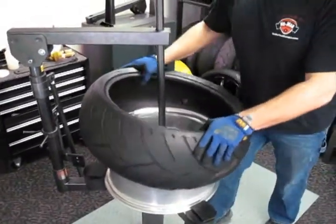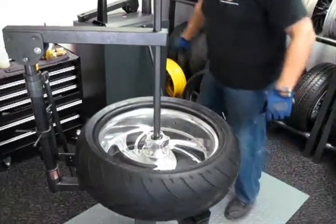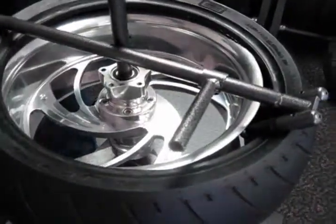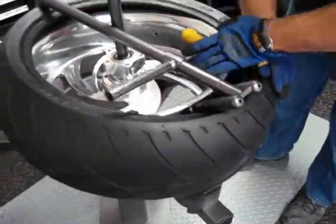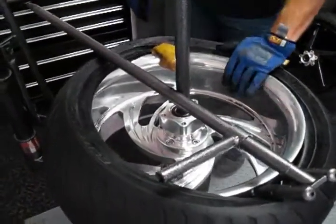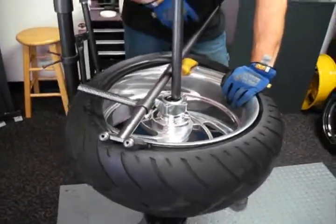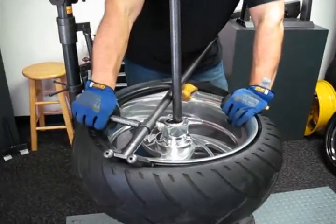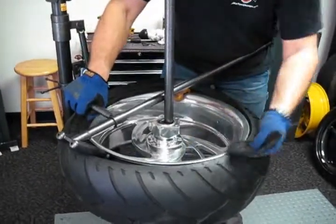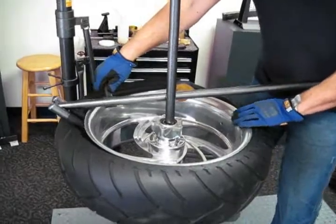Push the first half on. If your rim slips, not a problem — you didn't damage it, just push the cam and notch tighter. Use the two-prong end of the bar to mount the tire. Insert it over the frame arm like we discussed. For this tire I'm going to use the yellow thing tool to help keep the bead from creeping. Pre-install as much of the tire as you can, back to about 3 o'clock. Keep the tire in the drop center with your left hand. Position your body to push the bar with your left hip and pull the handle with your right hand — only your right hand is on the end of the handle. You can see the tire creeping into the drop center because we lubed it, and the tire pulling over the face of the rim with little friction.